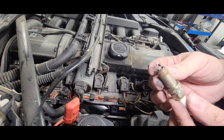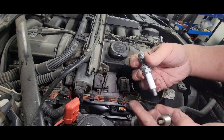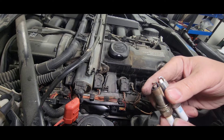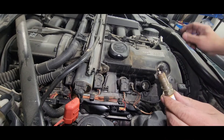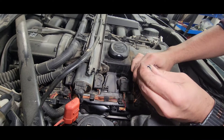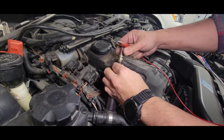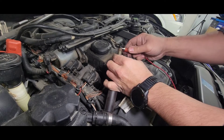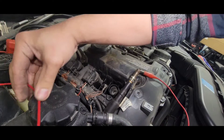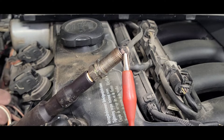Got a magnet — moment of truth. Yeah, it's not bad. Here's a new one. The original is Bosch, I got an NGK — it's all the same. The gap on those two is not bad, pretty close. We'll do a spark plug test — connect the coil, connect the spark plug, ground it out, and let it rip to see if there's a spark. Ground the spark plug to the strut tower nut on the block, coil connected to the connector. Let's start the engine.